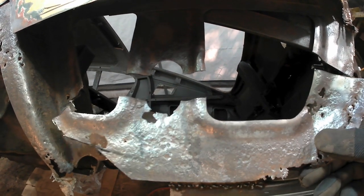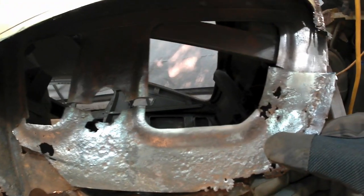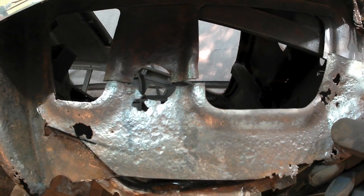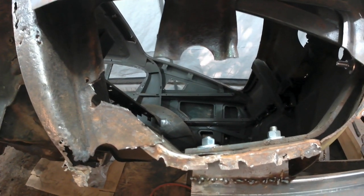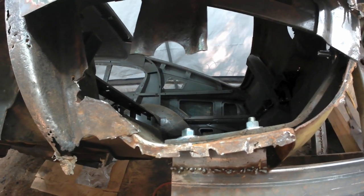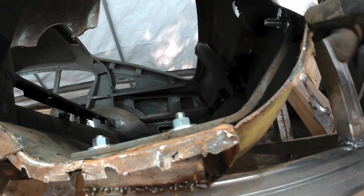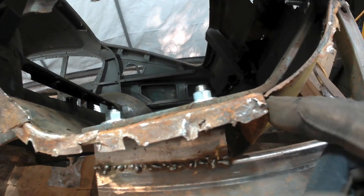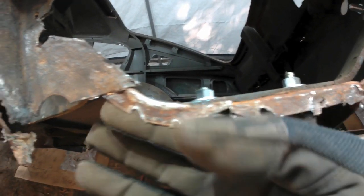As I mentioned in the last segment, I'm going to cut out this piece of the inner stiffener at the rear. I've done that, and as expected, there's going to have to be a little bit of work done on flanges. Here along the curve of the rear valance, you can see this flange is going to have to be rebuilt, and then down to here, and on the trunk floor as well, some of this is going to have to be rebuilt.